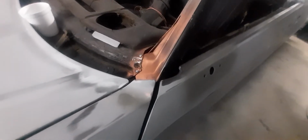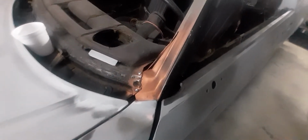Little knickknacks. I ran out of wire in my welder back there, so I need to finish tacking that in right there, right here. Clean that up and get that finished up. Knickknacks is ready for the high build primer right now, YouTube. I just got a couple of low spots. I got a low spot right up in here, right up in there, a little light low spot. And what else do I got left? Quarter panel. We done knocked that down and got that damn near to the final stage. It's ready for high build primer. So that's what I've been doing.